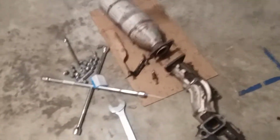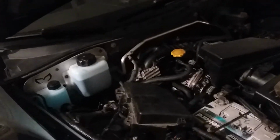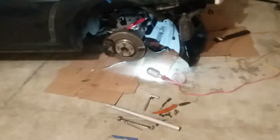I don't know if I mentioned it last time, but the oxygen sensor I had to cut off. So in order to get to that, I'm going to have to take the oil filter out, hopefully not make a mess, and disconnect it from back by the firewall, take the cord out. I do have one. It's supposed to be here tomorrow. Yeah, we'll see about that.